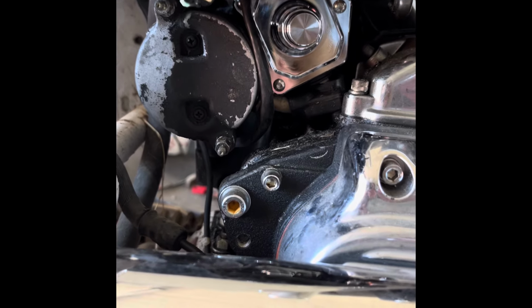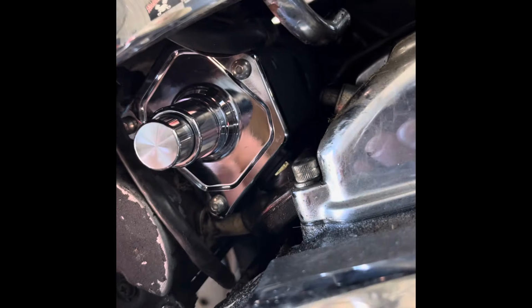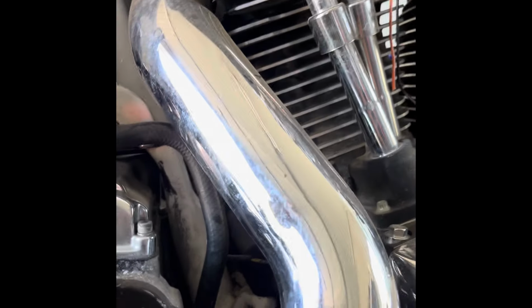Damn. All right. So the next thing I can think of is the power cord here. You see this rigged up crap right here. That runs down to the top of the starter. So I've got to pull the oil tank so I can get to that, and maybe I just need to clean that connection there. You know, they corrode sometimes. I don't think I'm getting enough current to the starter, because he's told me, and I trust this guy, that this thing was running.